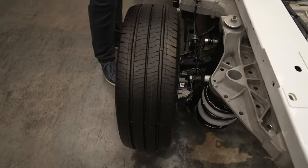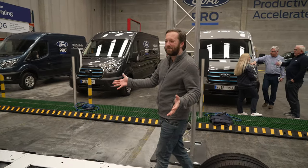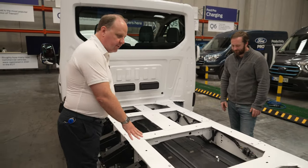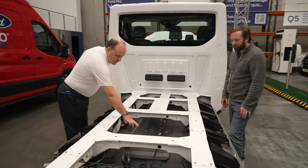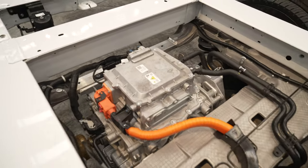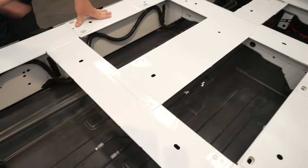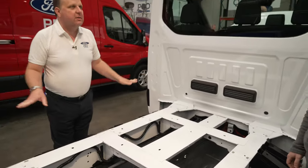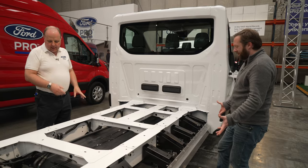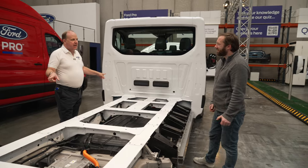The main thing people will talk about is the battery itself — water cooled. There are cooling lines going to the inverter as well, sharing the same cooling system. The feeds for the battery are at the front under the cab, with a cold plate underneath the cells providing the cooling.